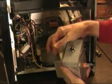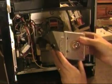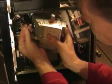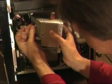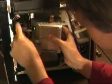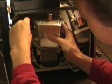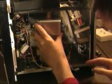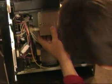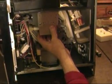Now it's ready to go back in. I'll plug in the connector for the main high voltage power. I should mention that this unit had been unplugged for weeks and I also shorted the capacitor when I first pulled it out — I just didn't show it on the early part of the video. I'm connecting up the thermal sensor and getting the magnetron positioned back into the oven.